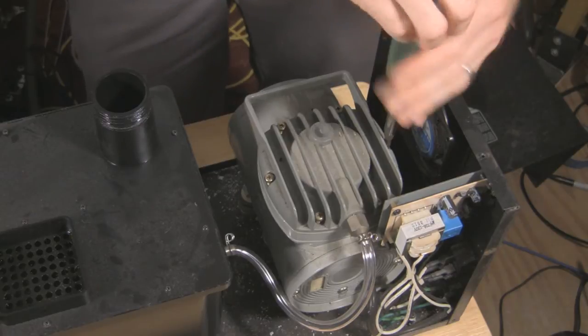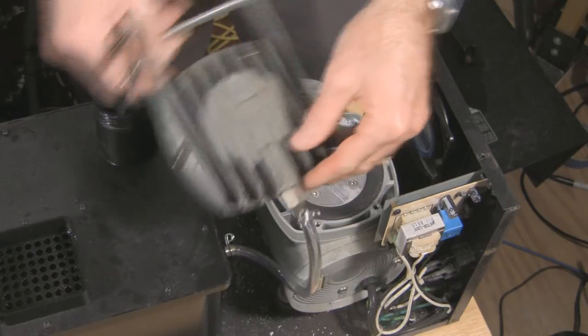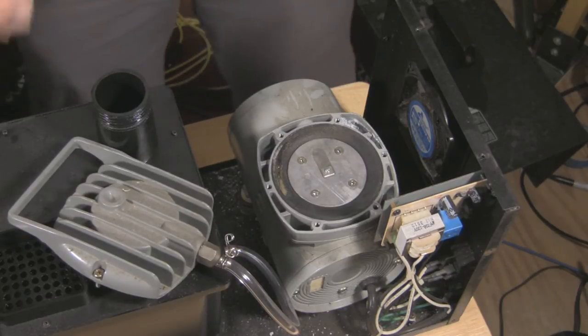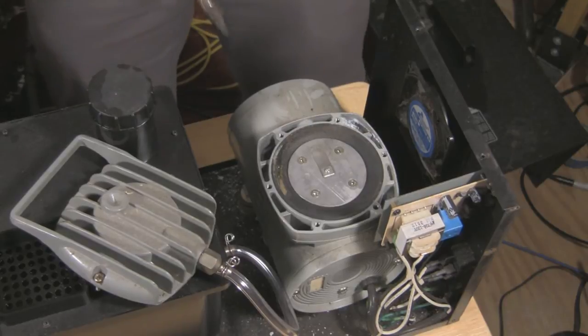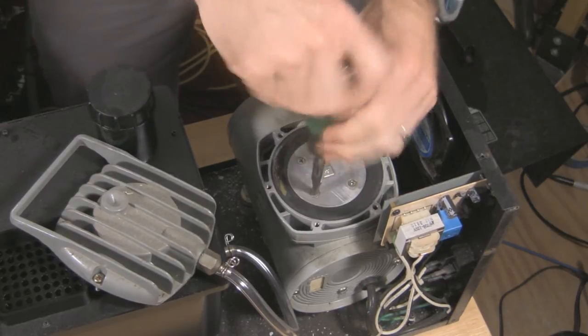This is just a basic air pump. When you've got all six screws loose, you can remove the top of the compressor. Make sure the screws don't fall in — I'm going to put the filler cap cover back on so nothing falls in there. Now looking at the top of the compressor, there's four screws on this cast aluminum plate. Remove those.